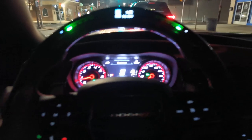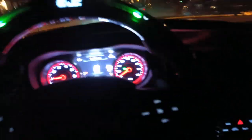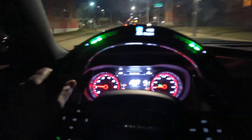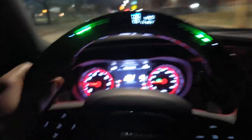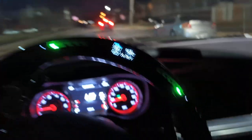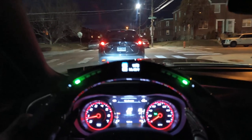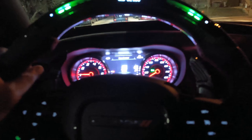Make sure your steering wheel is straight when you're putting this on because if not your steering wheel will be off by a bit. My thing is I needed an alignment already, so with a regular steering wheel it'll be evident, but with these lights being truly centered on the steering wheel, the fact that you need an alignment will be more evident. Mine's kind of veering to the right just a bit, and if I center it I veer off to the left. But overall I'm really satisfied with this — I'll do a more in-depth review at a later time.